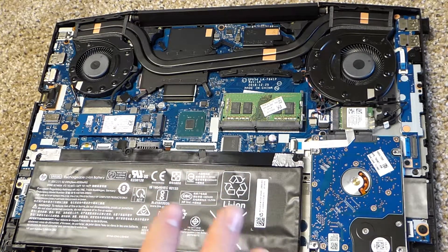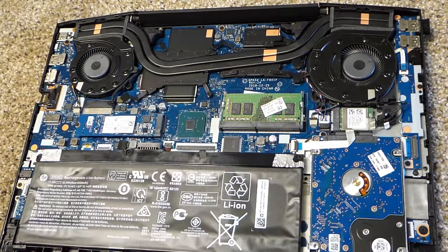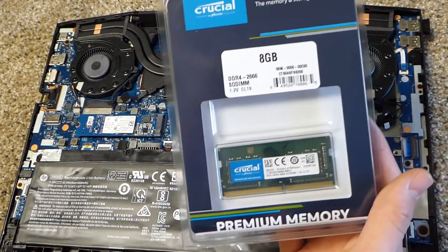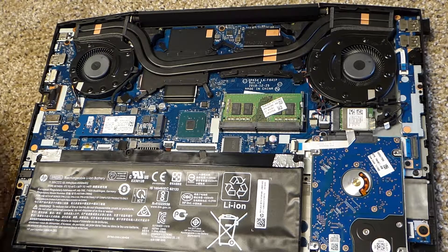Here's the inside of the laptop — don't touch anything unnecessarily. Here you can see the RAM; there's one slot filled with 8 gigs. I'm going to add another 8 gigs. This is the RAM I chose right here, it's Crucial, the exact same as what's in here — another 8 gigs. I will link this below, although there's a good possibility you're going to need a different type. This is 8 gigs of DDR4 RAM.